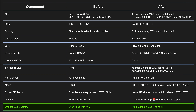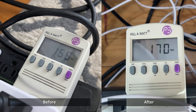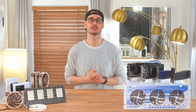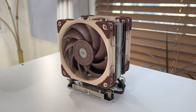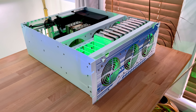And considering everything that changed, the power numbers were actually kind of surprising. I measured total system usage before and after — it used to sit at around 155–160 watts, and now it's closer to 160–170 watts. It wasn't a scientific test by any means, there were too many variables that changed, but even with the CPU, GPU, fans, and SSDs upgraded, the overall power draw didn't spike much. So for about 10 extra watts, the system is now way quieter. I actually doubled the RAM, added some SSDs, swapped out the GPU, added an active CPU cooler, and it now runs a Platinum-level CPU. A big part of that efficiency is just not running those old fans at full blast anymore, and some of it might come from the titanium power supply too. And hey, if I really need to squeeze out some more efficiency, I can always set the RGB to green.